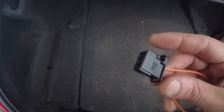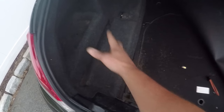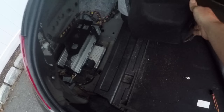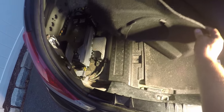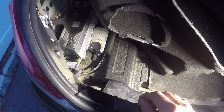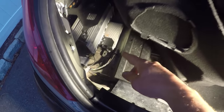When you get the female version, take your trunk apart to get access to the satellite radio unit. Lift this up and over here on the left pull all this apart — it'll be a little harder than that, but you'll get it. Once you have this cover removed, you'll see your power amplifier here and below that your satellite radio. This is a 650 — it may be in other locations in your vehicle, but for the 7 series and 6 series it should be the same.